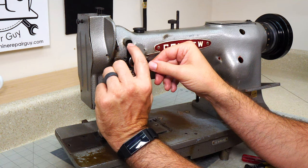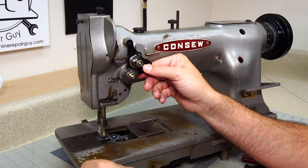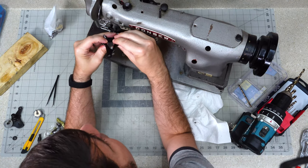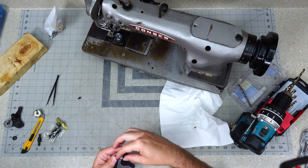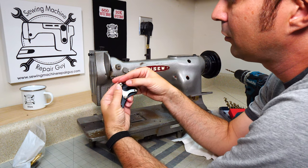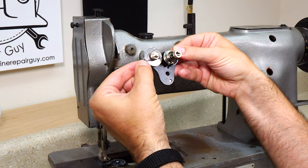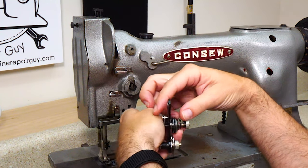What I'm noticing here is that this hole right here is too small, so the screw won't go in very well, and it's also not in the correct spot. So we're going to use a drill and widen out that hole a little bit. We'll see if that made it better. Now what I'm doing here with the check spring is there's a little divot on here, and I want to make sure the end of the check spring is in that divot so it'll push all the way down and you get pressure pushing down on that check spring. Then we'll install it.